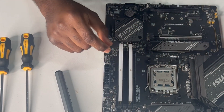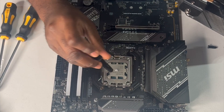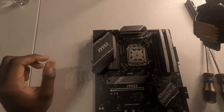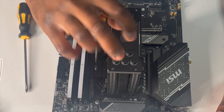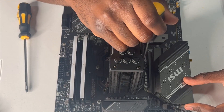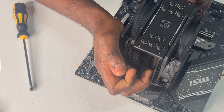Next we're going to put in the standoffs for the heat sink. We are going air cooled this route. So now we are going to put the cooler on top of the CPU. They say you want to put a pea-size amount of thermal paste, or you could do an X or whatever. After you put that glob on, you're going to set this in the middle. Once you get the screws to catch, you want to give it about a turn each side going back and forth, because you don't want to fully tighten one side and have trouble with the other. There's also an arrow telling you airflow direction — coming in through the logo, coming out to the back.